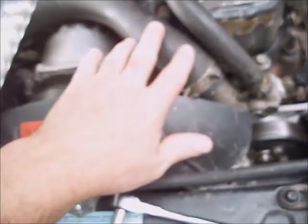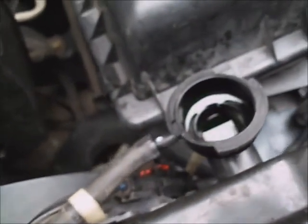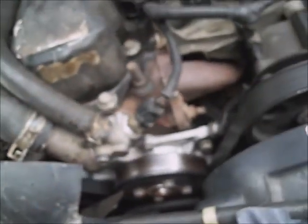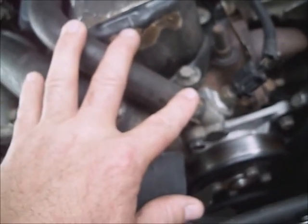Flush it with water. I'll just be using a radiator flush. Drive it for a couple hours every day, or a few hours for a few days. Let it cool off. Just be sure and add your flush to the radiator before you start putting water in it so you can get all of it in there. Then drain the flush out of it, fill it full of water, back flush it. I'm going to take these hoses off again and flush that radiator cleaner out.